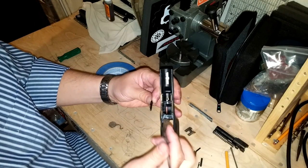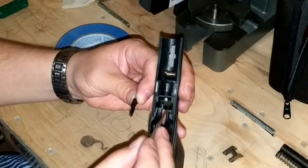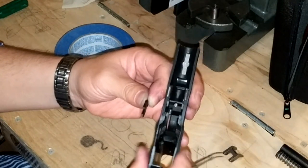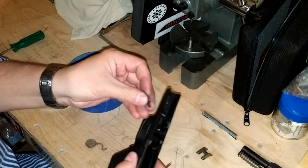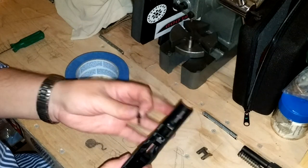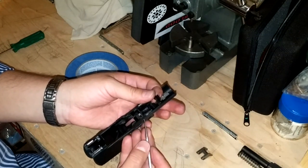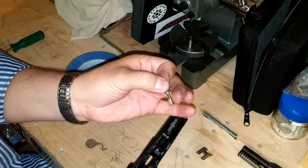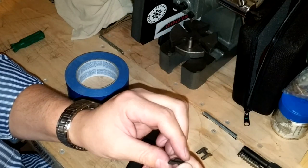See if you can see, we have a coil spring in there this time, and it is really difficult to get to. It's got this little piece of plastic here, this form, and one on this side as well, and you can't get to it. So it makes it a little bit more difficult to maneuver there. And then reassembly is pretty simple. You can reach in there with your pick and then push down on that spring and slide it back in. Make sure you slide it back in the right way. It still needs to have this little groove facing to the rear.